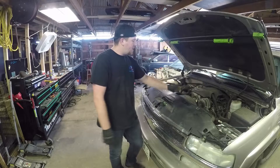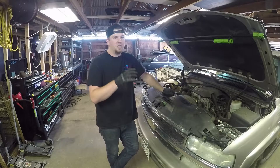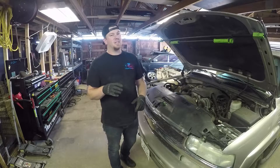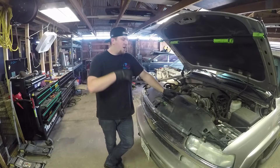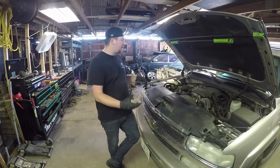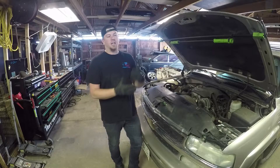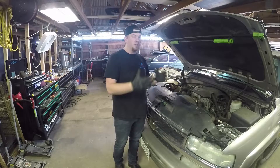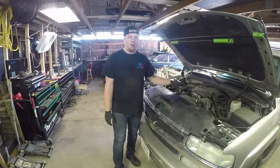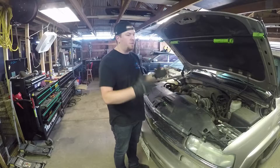She did spring a leak at the water pump. I'm not sure if it's going to be the water pump itself or just the gasket. We're hoping for just the gaskets but I went ahead and bought everything that we're going to need. I got belts, all the tools that I might need, new hoses, new thermostat, water pump, and just gaskets in case we can get away with just replacing that. I've already got the intake boot out and I got to pull this fan shroud out — that'll give us access to everything.